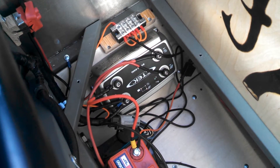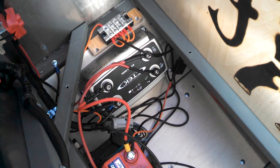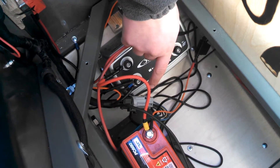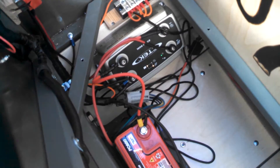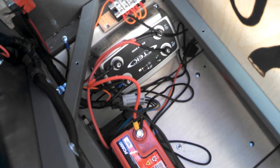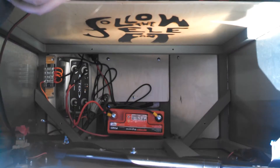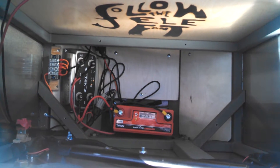That service battery is going to run our cool trailer lights that we put in yesterday, and we'll run some USB chargers for our bike communicators and cameras. Here is our main connection — this is where the harness goes through the trailer frame and comes out right up here, and that powers all of our stuff: the blinkers, the brake lights, all that stuff. This battery back here will be running our USB chargers and our lid lights. We're pretty happy that this CTEK works — it's cool to see it installed and running and actively charging that battery as we speak.